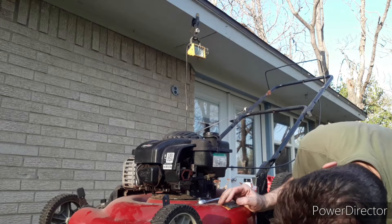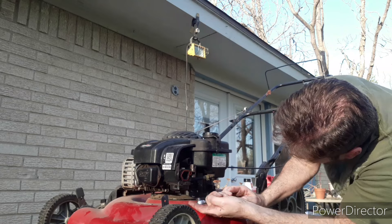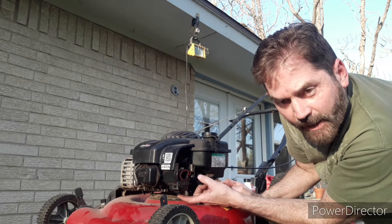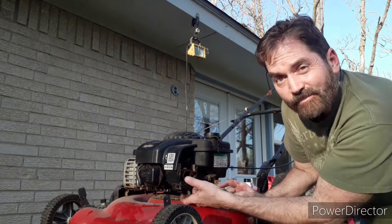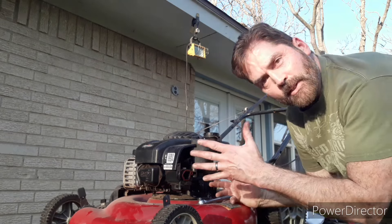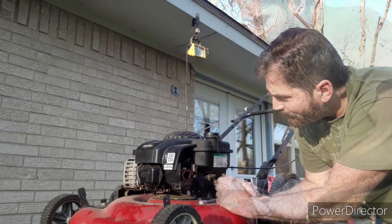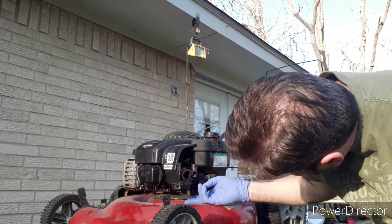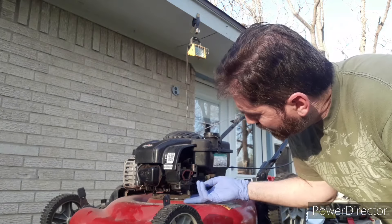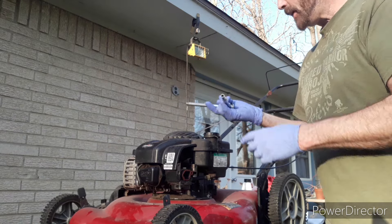I'm going to have to take some of this off to be able to see what I'm doing in here. This is the bowl that we're worried about — I may just drain it right here. There is an Allen wrench hole on the bottom of this thing. There's no room up under here between the mower and the carburetor to get a wrench in there while this is on there, so I have to pop this off. It is an 8mm bolt. Make sure this turns pretty freely — with a gas engine, it might start while this is up here, which would be a very bad thing. The stop bar is doing what it's supposed to do: grounding it and stopping the motor from turning.